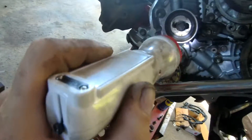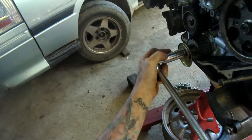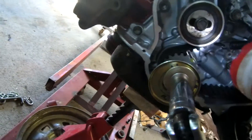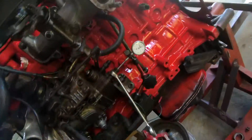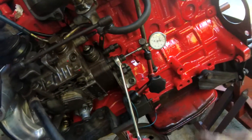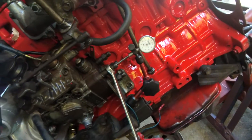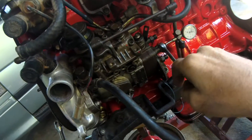We now have to find TDC again and measure what the plunger says. I don't really want the bar right in line with where I'm trying to look. That's TDC - that's telling me it's gone around. It goes clockwise, so it's gone 50, 55... 0.56. And we want 0.64, so we need to rotate the pump one way or another, which I've forgotten.